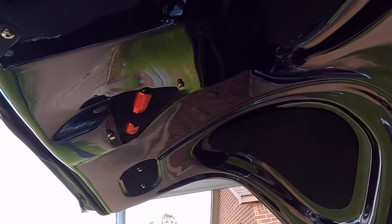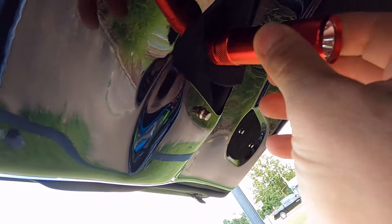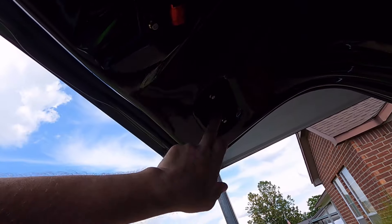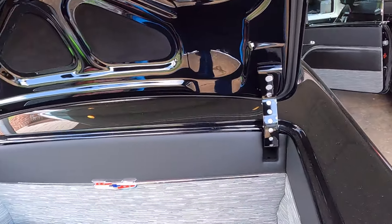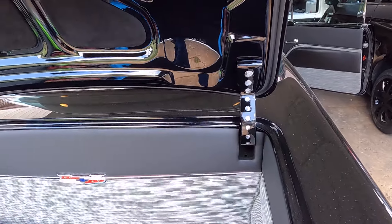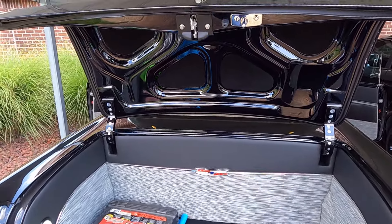When I originally started building the car I thought about doing the original trunk light, but instead I built a panel with imitation suede and velcro in that triangle cutout, with a little removable flashlight — I thought that was cool. There are also trunk hinge covers I made out of sheet metal. I drilled and tapped the sides of the trunk lid hinges and used stainless button-head Allen bolts. That is original bowtie dash trim for a '55 Bel Air in the back, fully polished with drilled speed holes and a flared step. They bolt on and hide the ugly hinge and all the hardware holding the hinge to the trunk lid.